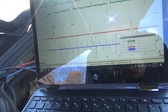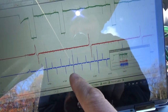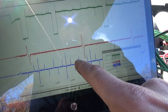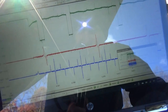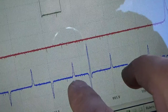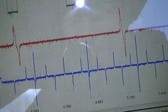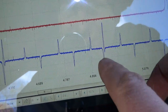This is super cool. The cam sensor shows one pulse per revolution of the cam. On the crank we have one huge pulse, then six up, then what looks like six down — I'm not sure if this is correct. It could be like a sync notch. It looks like a crank signal except for the sync notch — I don't know if that's appropriate or not.